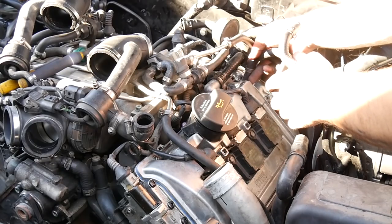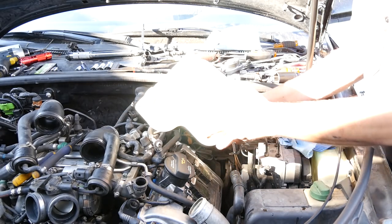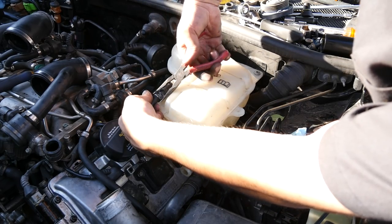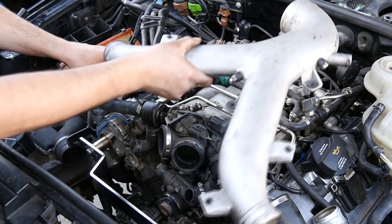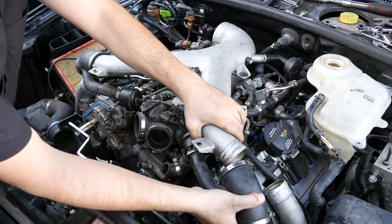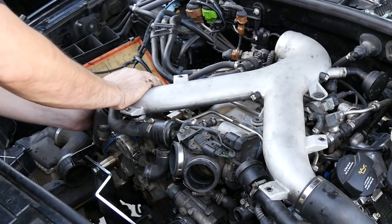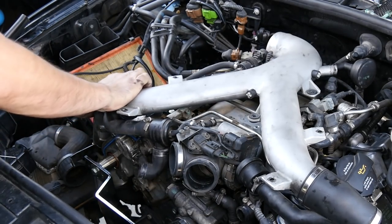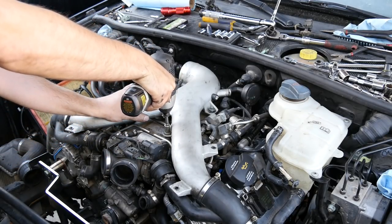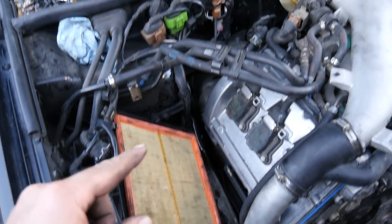Now it's time to put this hose back on the nipple that goes back there, and we replaced the clamp with a screw-on type which will be a lot easier. Next comes our coolant reservoir — reconnect the connector for the sensor underneath it, and there are three Phillips head screws holding it in. Reconnect the upper hose and lower hose. Then install our Y-pipe by pushing it into the hoses first, then tightening it down and pushing the hoses onto the side pipes. Tighten the three bolts and clamps. All that's left is putting in the filter box housing, but the filter is more or less all clogged up.